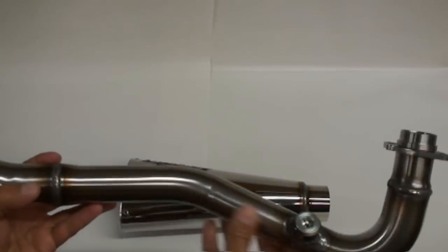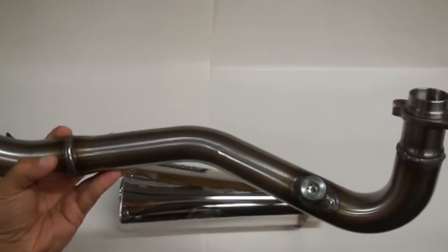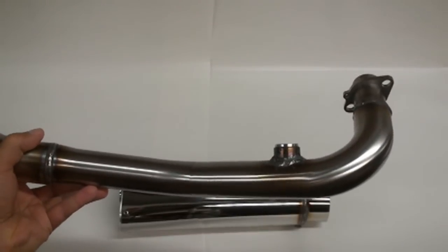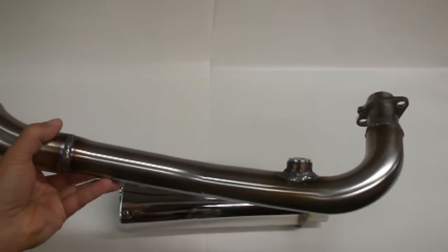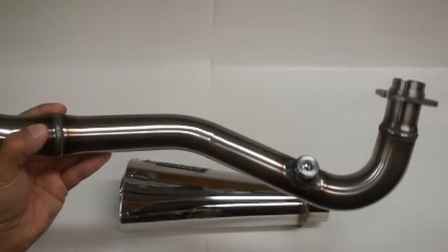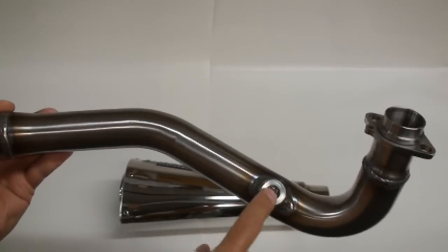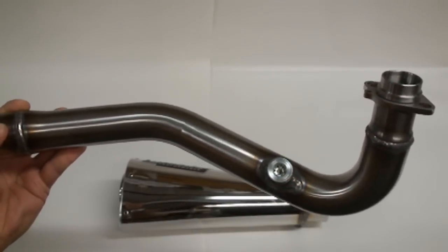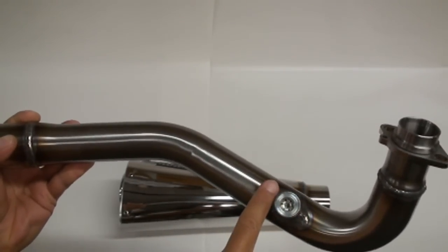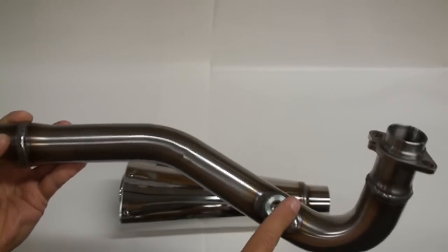The beauty of the Brock's 18mm bung is that it's awesome for you guys that want to tune your fuel controllers with a wide band sensor — it screws right in there. So if you're going to do a ZAFM, Dynojet Auto-Tune, or a wide band, you don't have to go out and get your header welded. They have an adapter plug for the stock sensor if you don't want to use that. Either way, both will work on the same header.